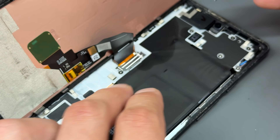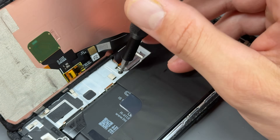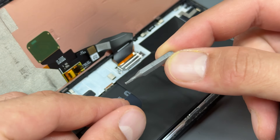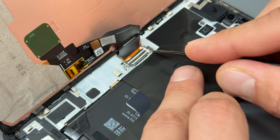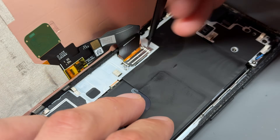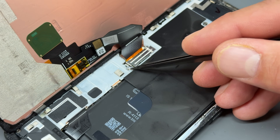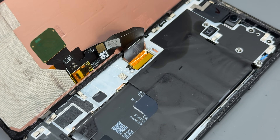Google are doing something about this problem — I think they're offering some compensation towards a new phone or a battery replacement, but you have to send it off to them or take it to an approved place. Next, take the screwdriver — I said T5 or T4 but it's actually a T3, look how twisted that is, it still works. Remove that screw, and then you have to ping this strange little connector out — I always end up bending these.